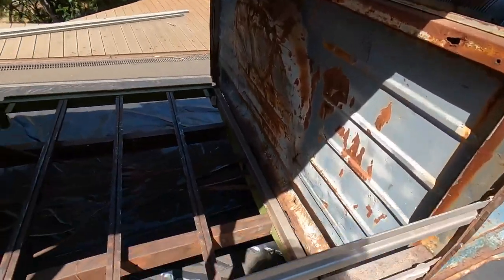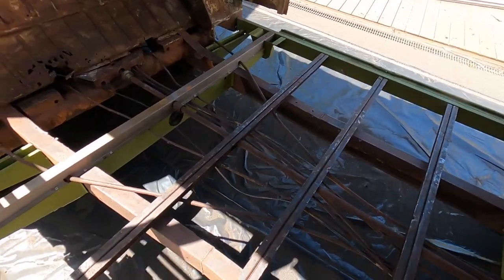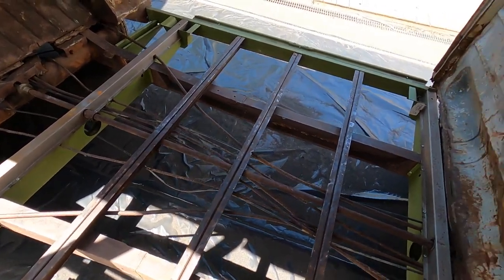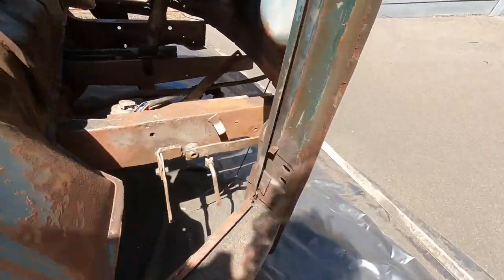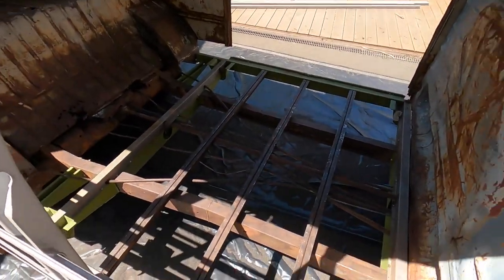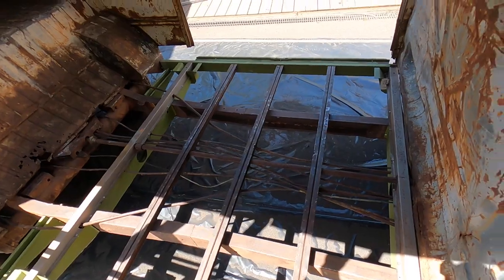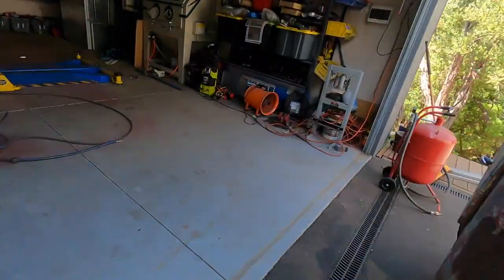Okay, so after the damage, oh, I don't know, we'll see. Yeah, it hasn't done too bad of a job. This garnet's probably a little bit finer than what I wanted, so it hasn't really stripped it right back to bare metal. It kind of has a bit down there. But all in all, I'm just trying to get the real heavy stuff off it, which it did through the girders there. And I did a little bit in the engine bay.